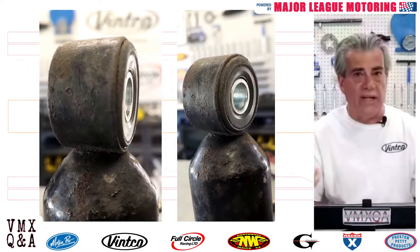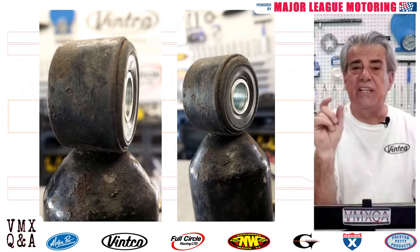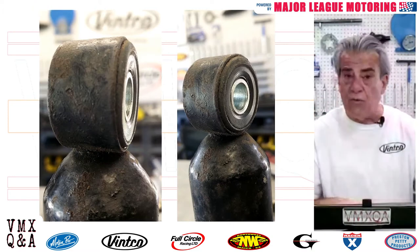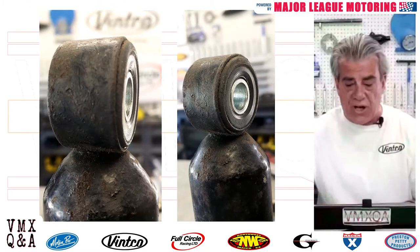That's why I recommended not torquing down all the way in a situation like this — using an eyelet or maybe some smaller washers that are not going to bind against the rubber on the grommet, so you get a good fit with your shock.